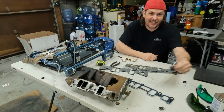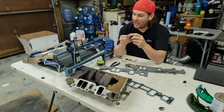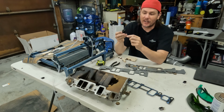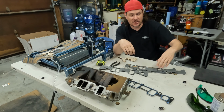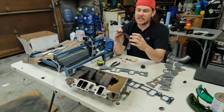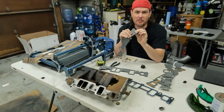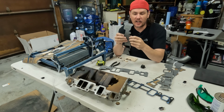On top of it, I went online and 3D printed this thing, which is an air assist nozzle. You've got a little hose on there, this little hose that I've got running over here. I hook it up to the air compressor, and it blows air out as the laser is cutting this stuff. It keeps the cut channels clean. You can see here I've got one that failed because I didn't have air assist on it, or I didn't do it long enough. It won't get all the way through the material because the soot will build up in the channels and clog everything up.